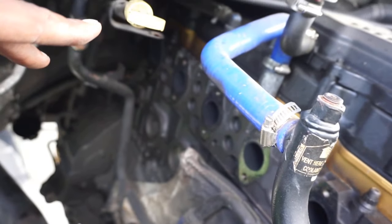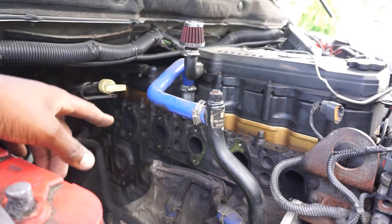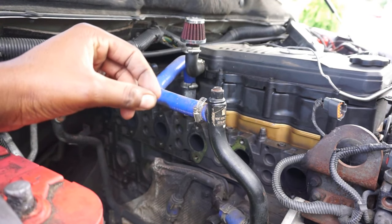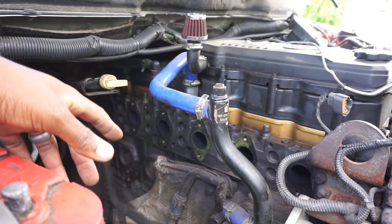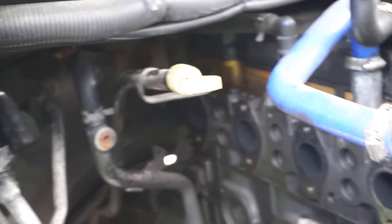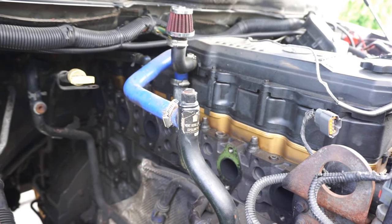First order of business — I'm willing to bet we had some sort of minor exhaust manifold leak coming from the head where the manifold connects. When I was taking off the manifold, the back one and I think this one right here — all three of those were finger loose. I initially torqued it to spec, which I believe is like 31 or 35 foot-pounds, and I torqued all of them — even the ones in the back using a special allen head. Everything's black back there so it's hard to see soot, and my EGTs were always fine.